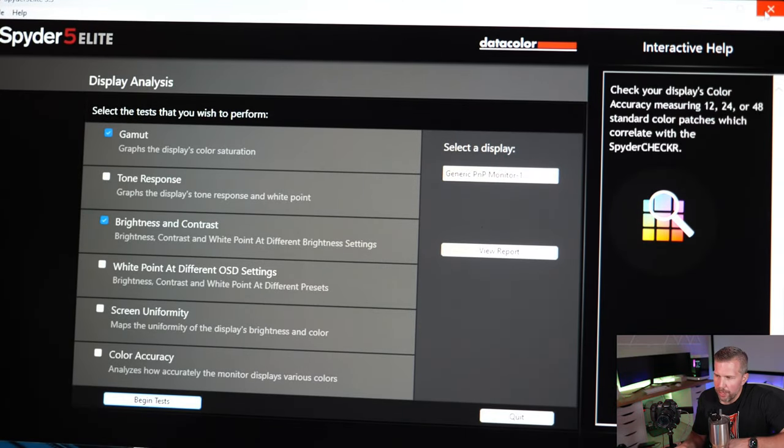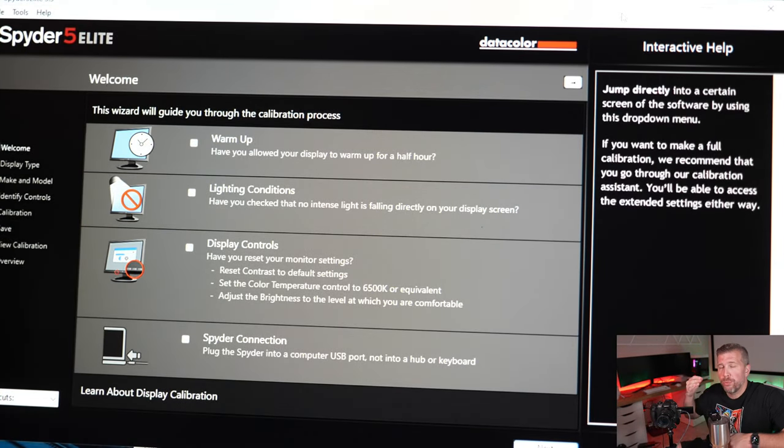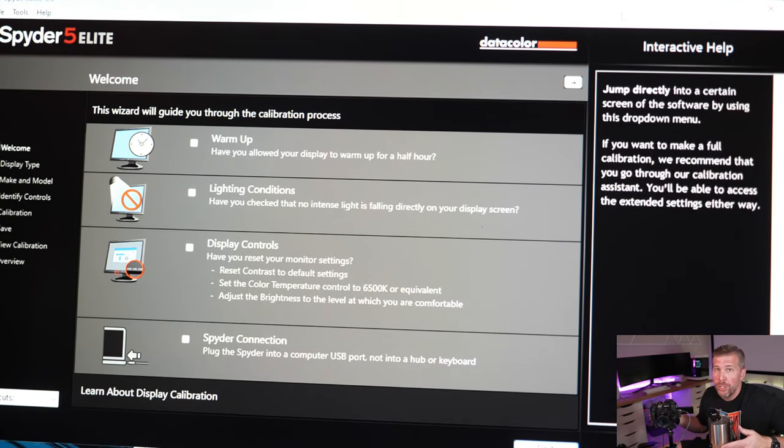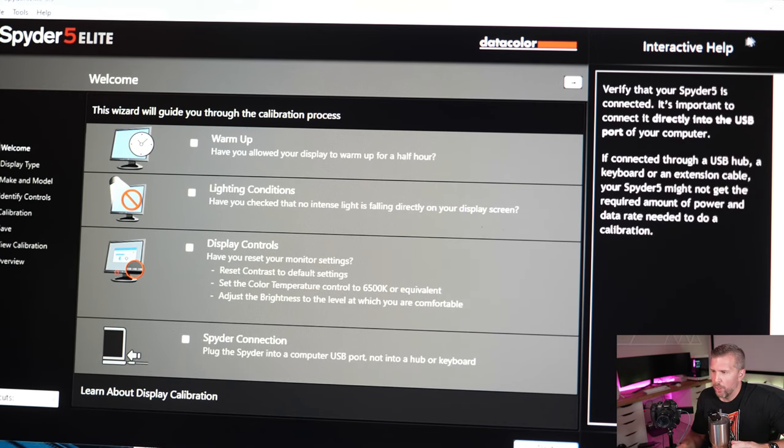And in general, I would say if you're going to be looking for a higher quality display, you really would ideally shoot for 100% sRGB coverage. And you probably can get that if you're willing to go down to like a 3050 Ti graphics card. At this price point, at $1,100, you can get 100% sRGB coverage, maybe at $1,000. Right? For $1,000, you might be able to get 100% sRGB coverage in the right laptop, but I don't think you're going to be able to get that with a RTX 4000 series laptop right now that I know of. So we'll have to see.